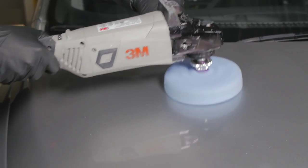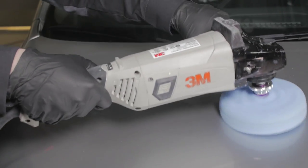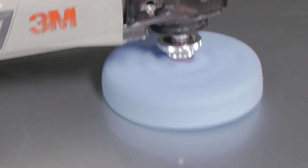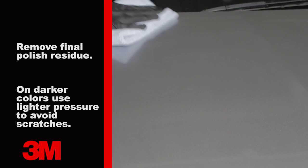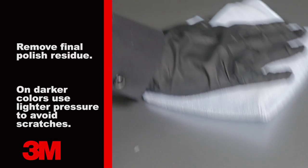To effectively remove extremely fine polishing swirls, especially on dark colored vehicles, polish the entire repair area with 3M Ultrafine Machine Polish and a 3M Blue Foam polishing pad between 1400 to 2000 RPM. Use light pressure. Using a clean detail cloth dedicated to this step, wipe off the remaining wet film of Ultrafine Machine Polish, revealing a swirl-free finish. Dedicating a 3M detail cloth to this step is strongly recommended as this will eliminate re-scratching the surface due to coarser material being trapped in your cloth.